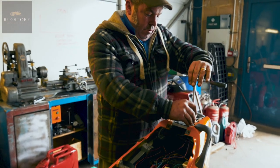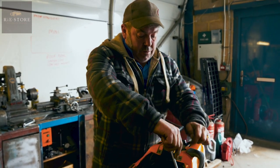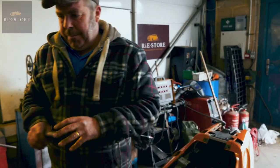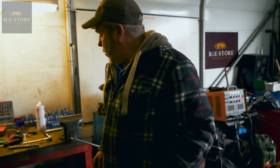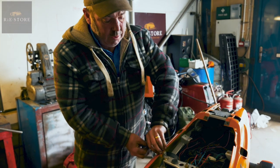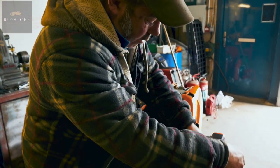So when a bike's been laid up, the first thing that normally goes wrong — normally it's fuel. They get fuel left in the carburettors and it just blocks the primary jets. So if you're going to lay your bike up for a while, the best way to avoid this: run it out of fuel completely, probably drain the tank as well, because fuel goes stale so quickly nowadays. Then fill it all up when you start it again. It's a bit like people putting their lawnmowers away in winter — they just don't start because they leave fuel in the carbs.